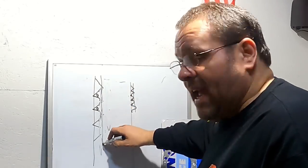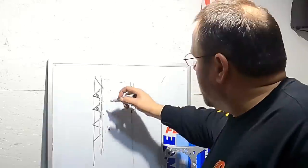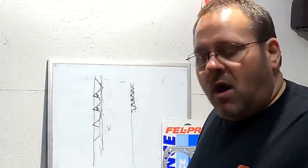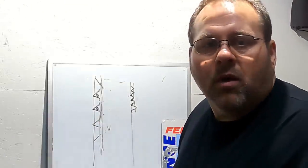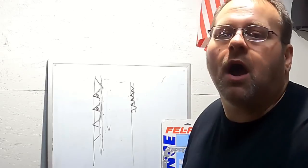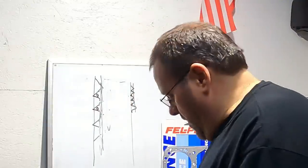And that material that it takes off there, that all goes into your oil pan, and your motor's got to absorb that. So we can just avoid all that. We can get a quicker break-in time on the engine, have it good to go within, you know, it running for an hour. We take this engine, we're going to let it run, cycle it a couple times in the shop, be tuning on it, and it'll already be good to go. I'll change that break-in oil out of it, and when we go to the track, we're good. All right, so that's the reason for that.